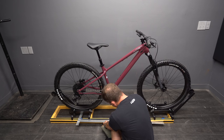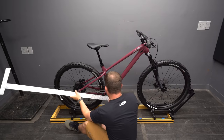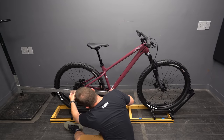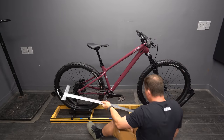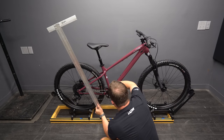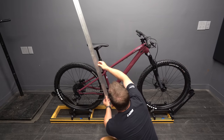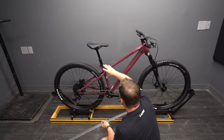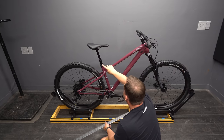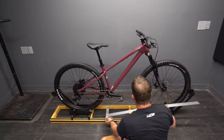Rear center, 435. Good, I was worried it was going to be 440. Let's see. Actual chainstay is indeed 440, but rear center is 435. Seat tube length, this is kind of landing a little ahead of the bottom bracket like we like to see. That's cool. 395. I love that. Love the short seat tube. Bummer they didn't just run a longer dropper, because if anyone could, this bike could. Front center 765.